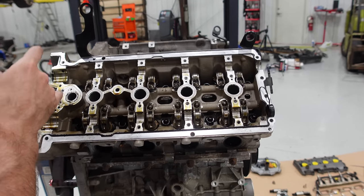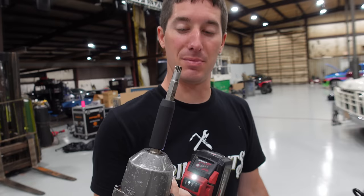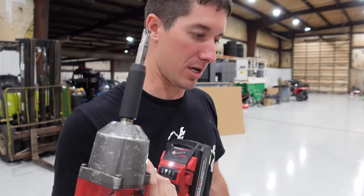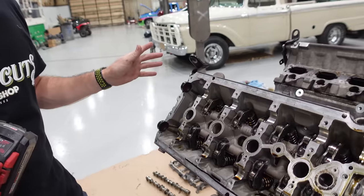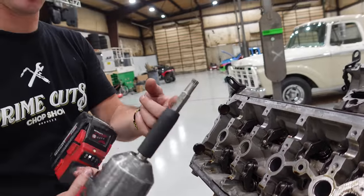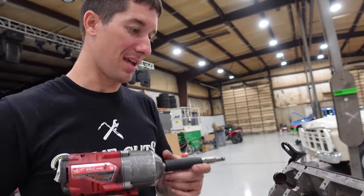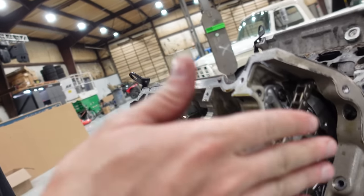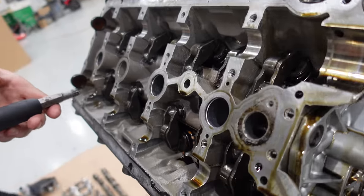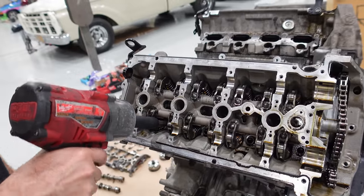Pulling the heads is going to be a bit of a job, but we're basically at that point. This head is held on by eight gigantic M12 triple square fasteners. In case you guys are keeping track, basically every single thing — almost every bolt on this engine is T30, with a couple T20s, and you'll need your triple square set. M8, M10, M12, M14 is all I've needed so far. The only thing I'm worried about is the timing chain; I need to make sure it will drop through the side of the head even though there's a little idler inside. The valves and valve springs are staying in — I don't want to pull any of that apart.